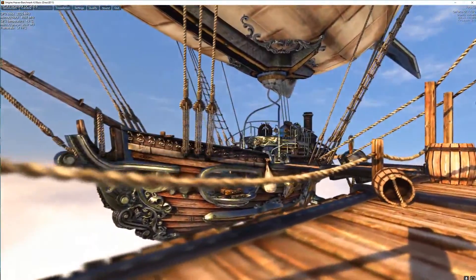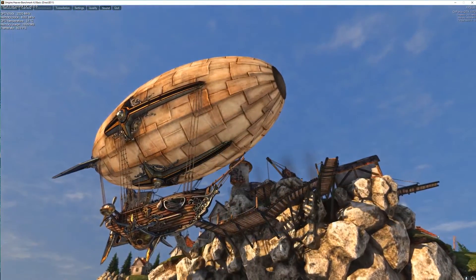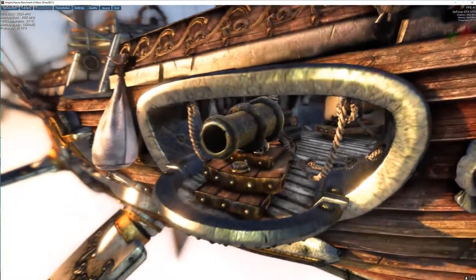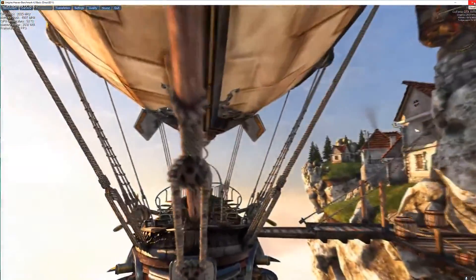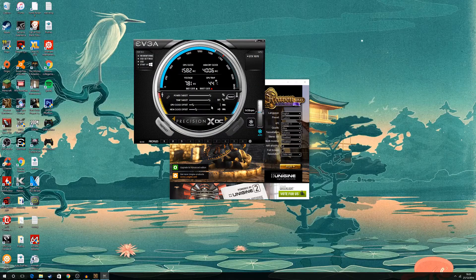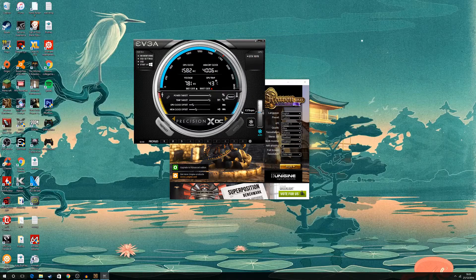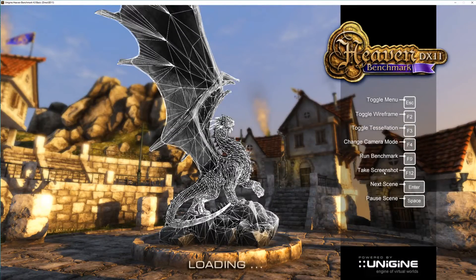I know this is going to work out, so I'm not going to let it run three times, but you really should if you plan on overclocking blindly — without already knowing the results are going to be positive. I'm going to close this and start increasing again. Now I know that the maximum overclock for this card is 125 MHz, so I'm going to dial in 125 MHz.